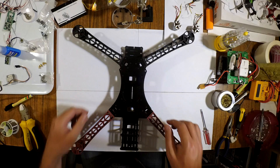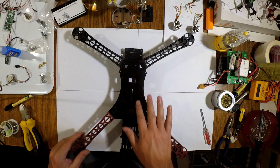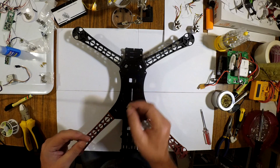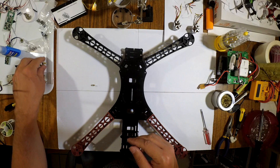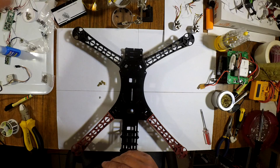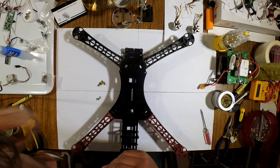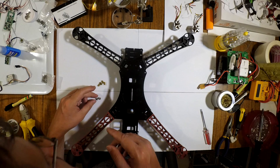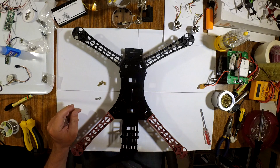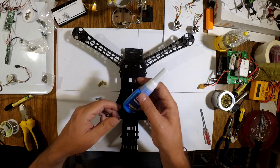I like the way they look — they look pretty neat. I'm going to be mounting standoffs to lift the board slightly away from the surface so the bottom of the board doesn't get damaged. I'm going to use these brass standoffs — I've got four of them. Now brass is a metal, so we'll need the screws as well. I'm going to be mounting these from the bottom and the screw needs to come through, then the standoff is screwed in on top.